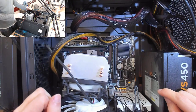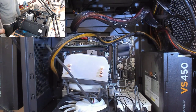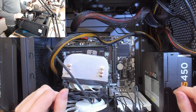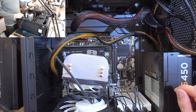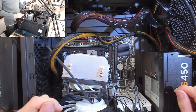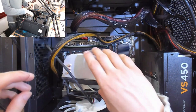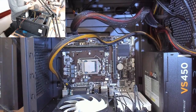So we're going to move everything back to the other motherboard again and just do a control test. And if we find that all of that is still stone dead, we know that it's definitely a dead motherboard. Again, I'm not quite sure how an ill-fitted CPU cooler managed to kill the motherboard. I mean, a cooked CPU I could understand, but I don't understand why the motherboard is stone dead. But just by good fortune, because I have almost an identical replacement here, swapping it out was easy enough to do. So let's take all this out and do another test.